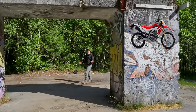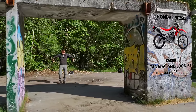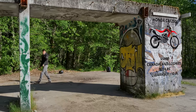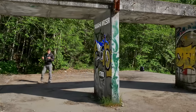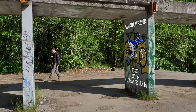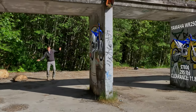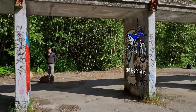So, options. The CRF 250L is cheap at $5,800, but it's a pot-bellied pig, hanging its 322 pounds just 10 inches off the ground. And the WR250R is lighter and higher at 295 pounds and 11.8 inches of ground clearance. But that extra height comes at the cost of a topsy-turvy, dippy-toe 36.6 inch seat height, and beginners hate that